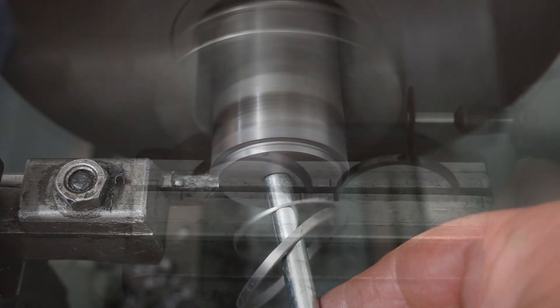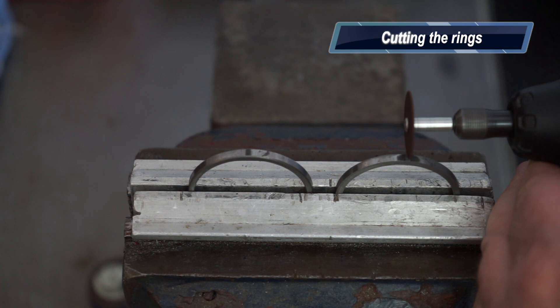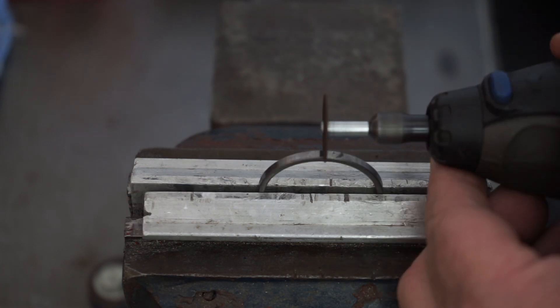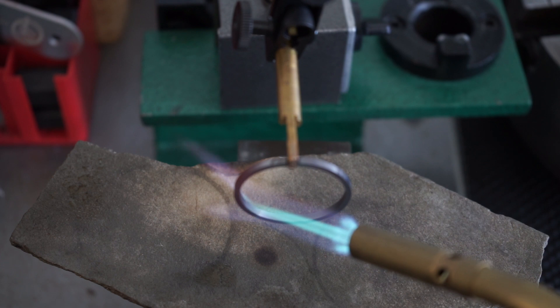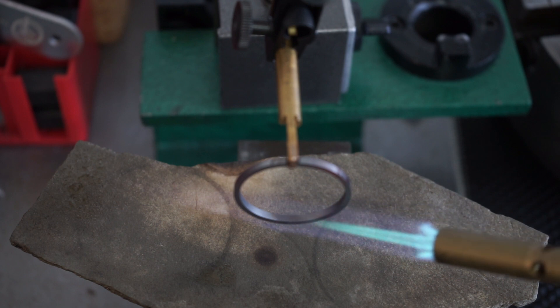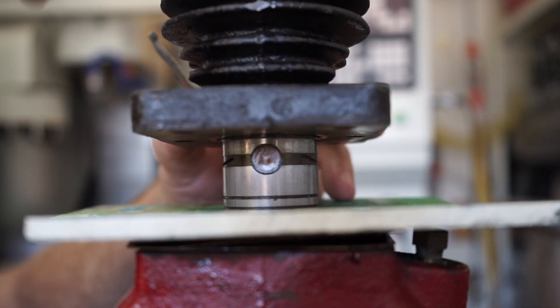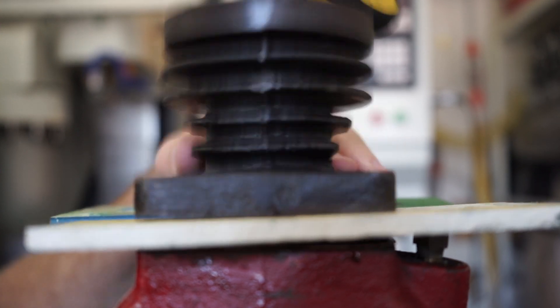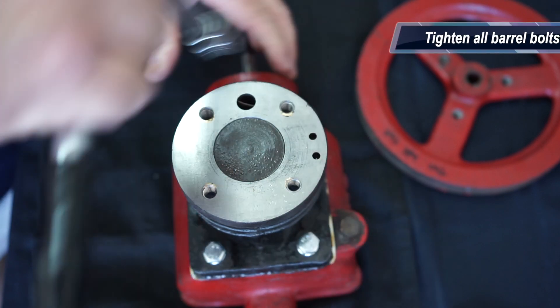Using a Dremel, this is how I obtained the end gap — by making a very small slit and then expanding the ring over a piece of brass I'd machined down, which I used to use to hold one of my GoPro cameras. That put a little bit of tension on the rings, and heating them up red hot, quenching them in oil, and then fitting them onto the piston. You can see that went on a little bit tight, but I got it on.